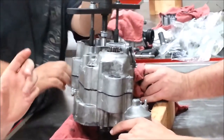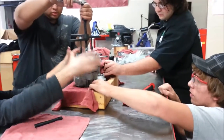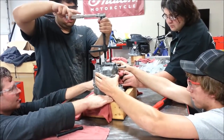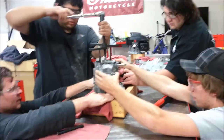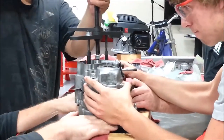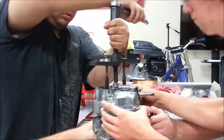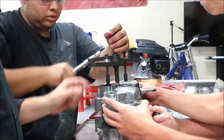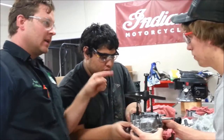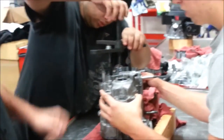Now, get down at this level. You're going to turn — let go here and lift. It's smooth turns, don't ratchet — nice and even. It's coming up beautiful. The only negative to the way we do it is it forces us to stop and get that nut off there, because if we try to keep going, we'd end up ruining that crank seal.